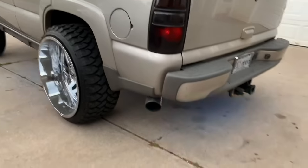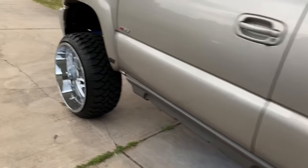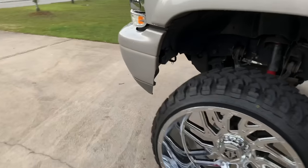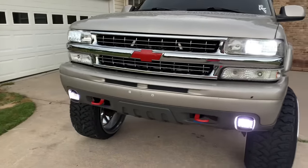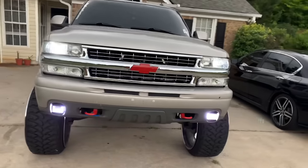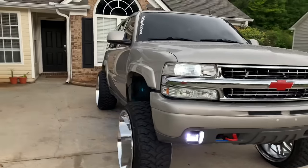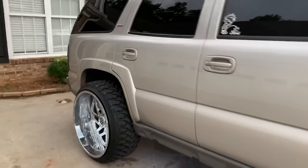It does have LED lights all around — Ultimate 7 lights — and I got it wired up to my fuse box. They give you another option to wire it up to your cigarette lighter but I don't trust that. I prefer to put it on a fuse so if something goes wrong it'll pop instead of catching your vehicle on fire. The LEDs are on all four corners of the truck.